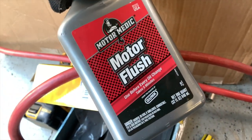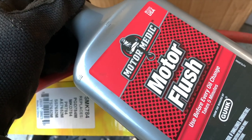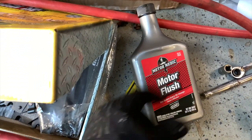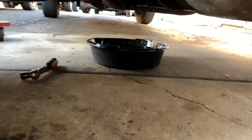Another thing: since I got all this stuff off, might as well change the oil. A recommendation from me — before you change the oil, use a Motoflush. I've been using it for a super long time since I got my first car. My older brother is a very good mechanic and he told me that before each oil change I should use this to get all the gunk out of the engine. It does a great job cleaning the inside of the engine. You pour it in where you add the oil, then let the engine run for five minutes before you drain the oil. So as you can see, I'm draining the oil right now.